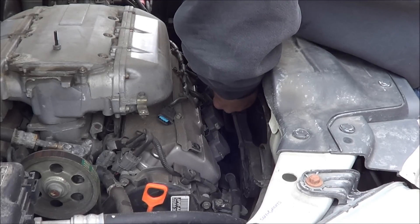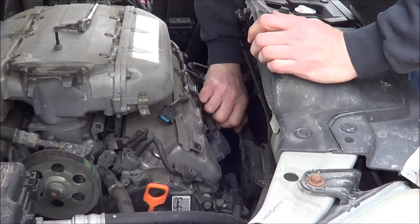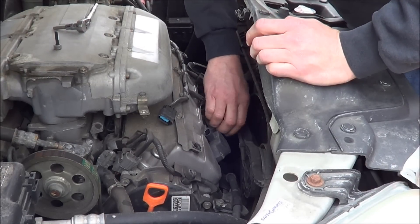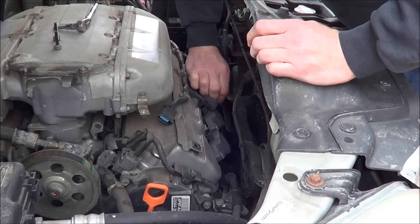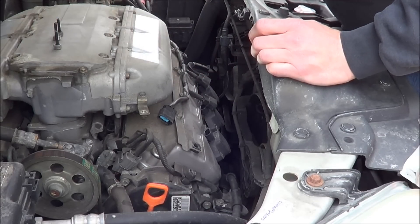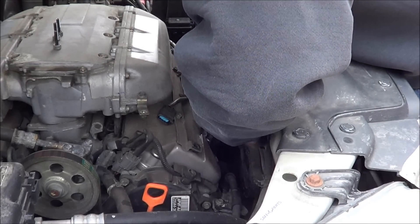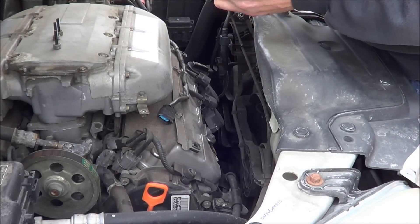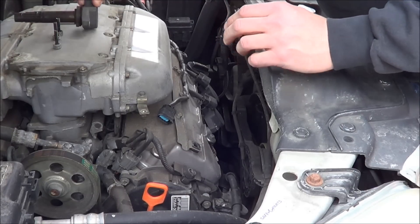Of course the plugs look really crappy — maybe I'll consider getting a new set of plugs for it. The ones in the back look like a real pain to change though, not as bad as some cars I've worked on. I can already have a good guess of what's going on — there's a lot of moisture on this, and it looks like the valve cover is leaking.